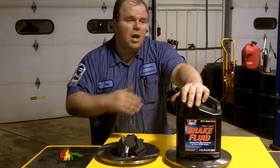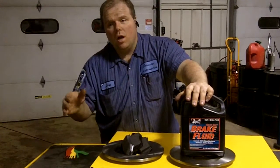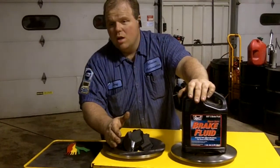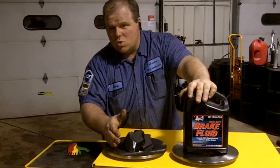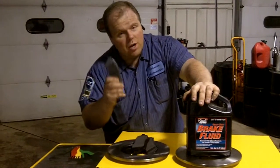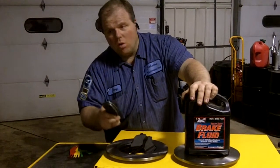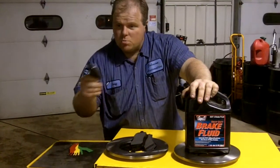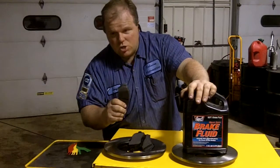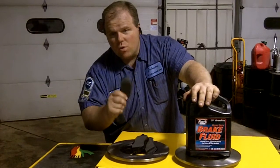I've had numerous people come in saying they've replaced all the components — new pads, new rotors, new brake calipers, new hoses — and still have one wheel that pulls. In some cases, it can be that the valve in the ABS controller is hung up, and that's what's causing it to pull one way or another. Also, believe it or not, brand new brake pads can cause a brake to pull from one side to the other. It can simply be a brake pad. That's why you should have a professional install quality, correct parts designed exactly for your car.